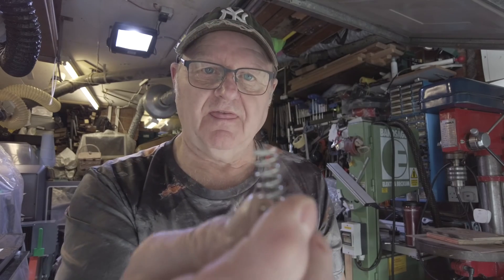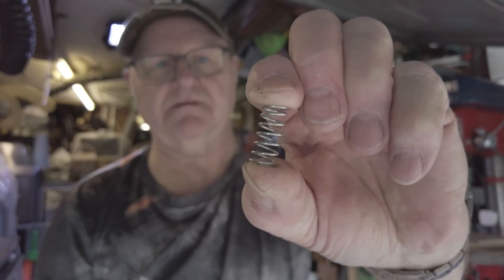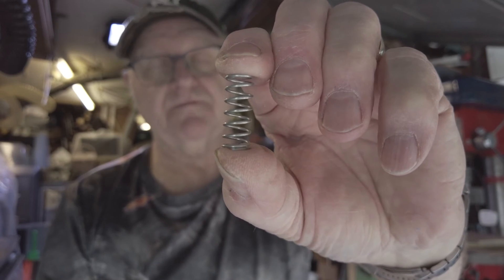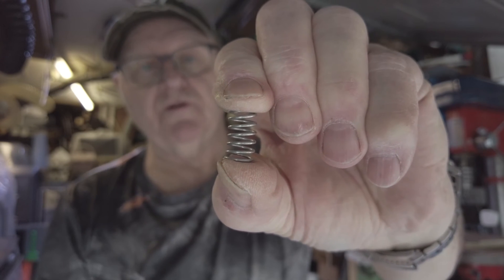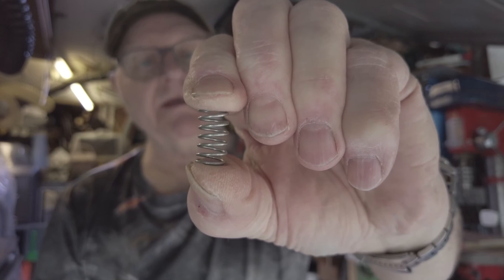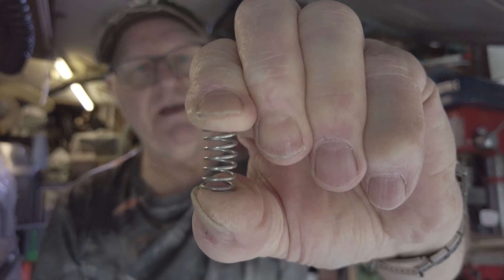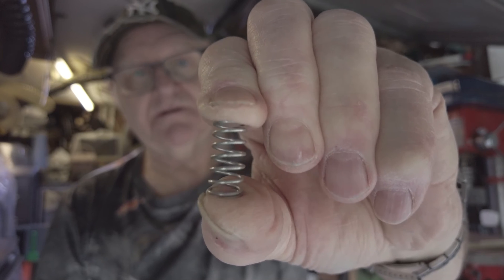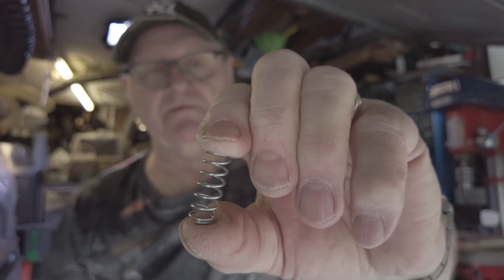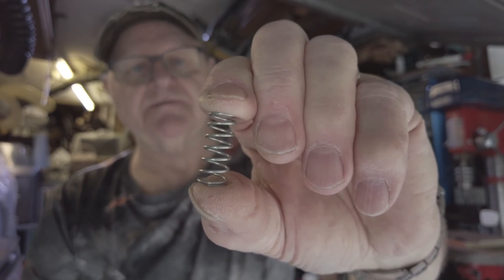I used the long ones — the long one was better for the X-Max. I put the short one on and couldn't get any adjustment on the back because it was too loose. You need a little bit of compression because they do compress. The five-mil bolt is quite long and it's compressed to about that. The hole that the bolt goes through is about half a mil too big, and the bolt does nowhere near the edges of the spring. That's what was causing the issue — it's an atrocious little bit of design really.